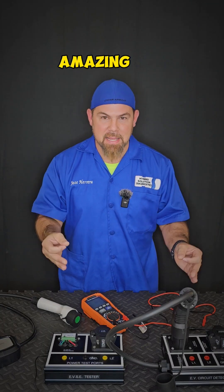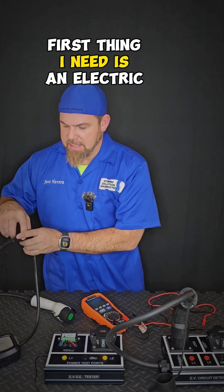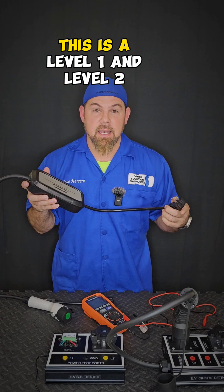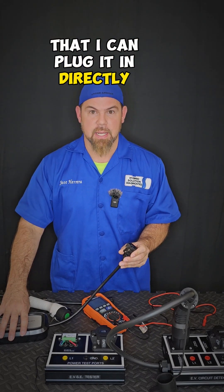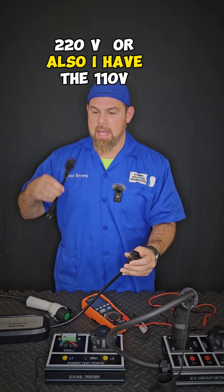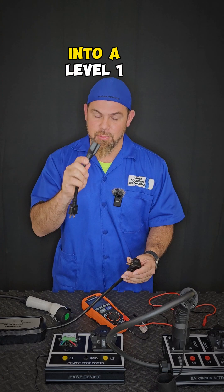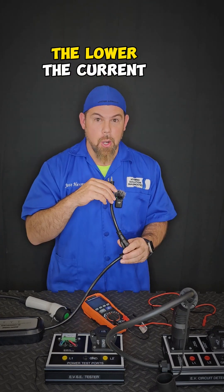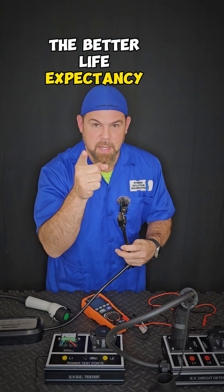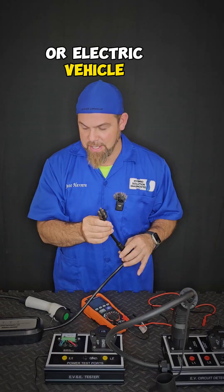This is exactly what this amazing creation from Professor John Foro has made. First thing I need is an electric vehicle charger. This is a level one and level two grid charger for electric vehicles that I can plug directly into the 220, and I also have the 110 adapter so I can turn my level two into a level one. If you've been following my channel, you'll notice that I hate the fast charger — the lower the current, the better life expectancy of your high voltage battery, whether it's a plug-in hybrid or electric vehicle.